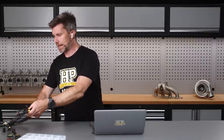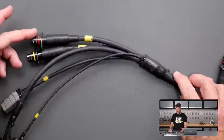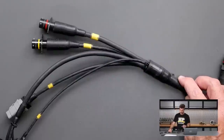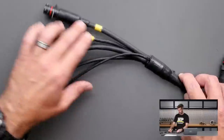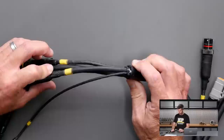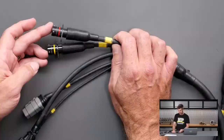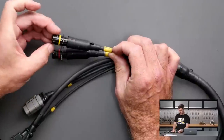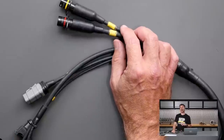Let's jump to our overhead camera. We've got one of our test harnesses here — a professional level motorsport wiring harness, actually part of our pro level wiring course that Zach built. There's a bit of variation in this harness. It's built using concentric twisting, sheathed in DR25, with the typical Raychem heat moulded boot used for transitions, all potted to make it 100% environmentally sealed. We've got two breakout connectors here — interface connectors for the ignition system and for our fuel injectors.